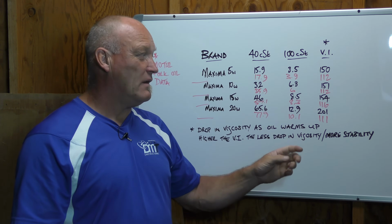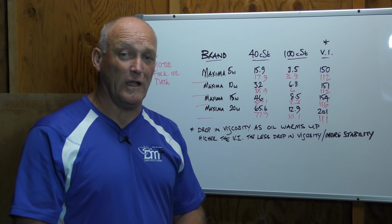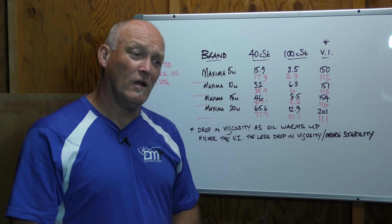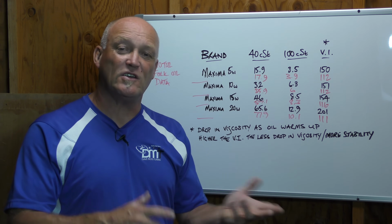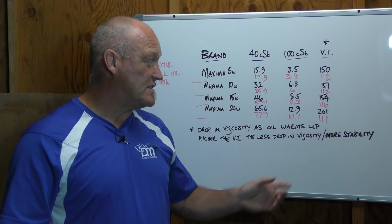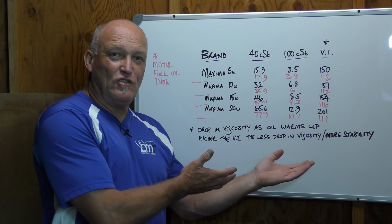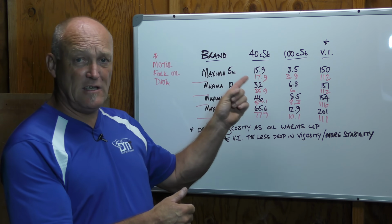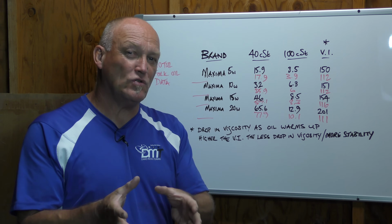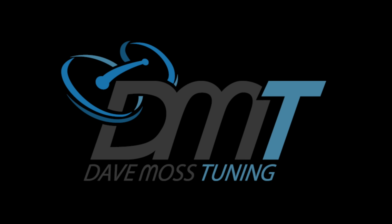It will be really nice to have that historical data to find the degradation rate, especially on VI, over X number of days. So if that is out there, if somebody can share the link for that we can all benefit from, thank you. That'd be great, because then we can make an even more informed decision on what we want for the bikes we own. So hopefully that's given you an insight into cSt, kinematic viscosity, viscosity index, and what oil would make the most sense for you to buy, for your bike, your environment, and your use.